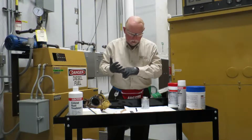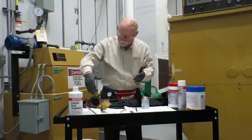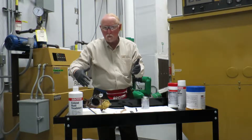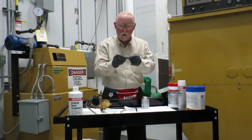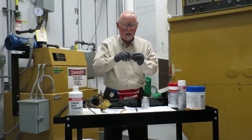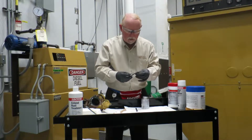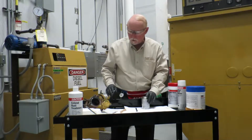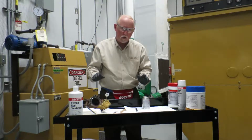Bond trim, foam, insulation, door and trunk moldings, weather stripping, and headliners — people are using it for these in some right and wrong ways. Basically, if you've got a piece of rubber like this, and you're putting like glass in it or whatever, you can use that to bond it. Lots of different things you can use green cement for, but I think the main issue we've always had over the years is how it's being used.